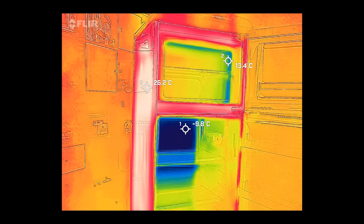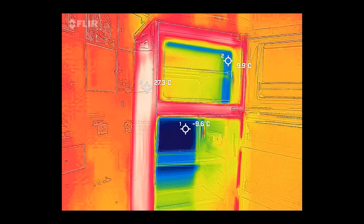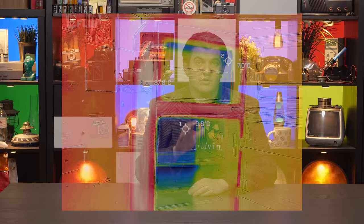There's more to this whole thermal design thing than I figured. The convection currents made by the sheet of cold, dense air falling to the bottom of the fridge are apparently very delicate, and messing with them in even the slightest of ways makes the fridge even worse. Go figure. Now, one last thing to try would be fans on some sort of a timer — maybe a 60-second blast followed by 10 minutes of stillness would churn up the air enough to mix it around, but not so much as to form those apparent dead spots. But honestly, I was getting real sick and tired of these fan experiments. And besides, we still had the utterly baffling thermostat to deal with.